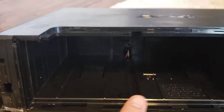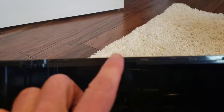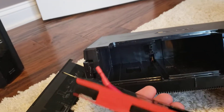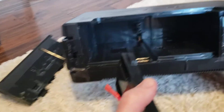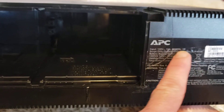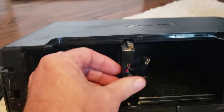Once you open it up, you're going to see a couple of slots. Notice these slots, and way in the back is where your batteries actually plug into the unit. If you look at the piece that fits in the middle of the original batteries, you'll see the power socket. The red side goes down — we'll call that down because the APC label is right side up. That's how that piece fits in there.